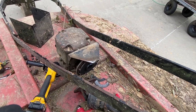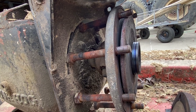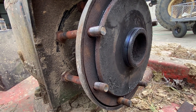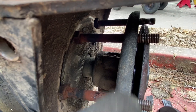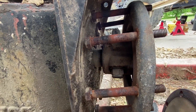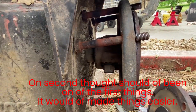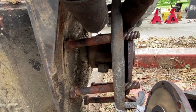Let me get a better view here. This is the disc — I was calling it a liner earlier. It still has parts of the fiber from the bad liner; it broke apart and must have been stuck to it since it was so thin. On the other side, what should be a liner looks like it's completely gone — totally gone. I'm gonna have to remove this from the shaft because I won't be able to put the liner in in this position. I'll have to undo the nut and slide the whole assembly off the shaft to replace the linings.